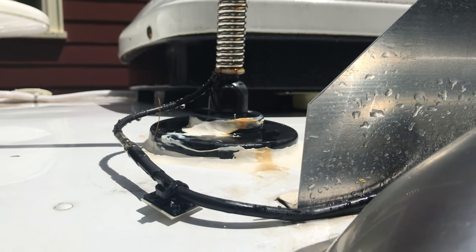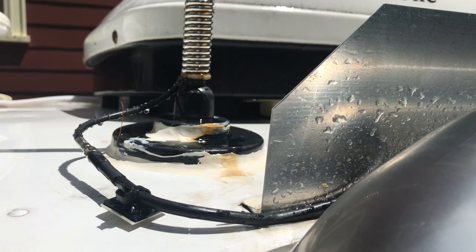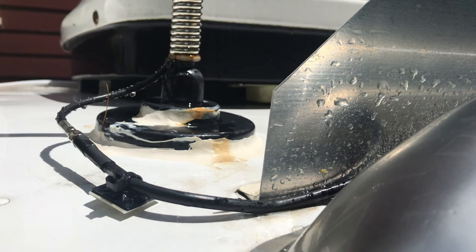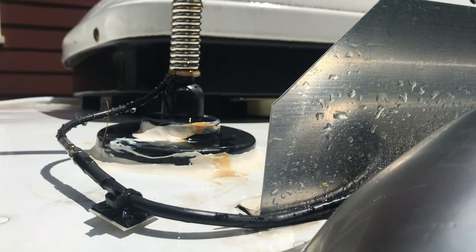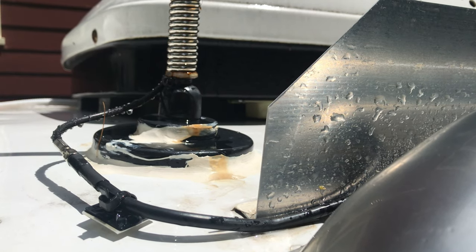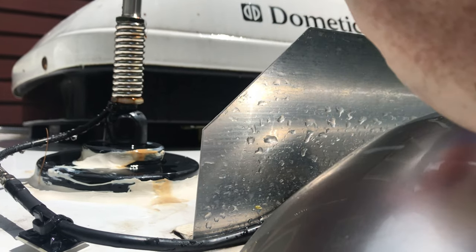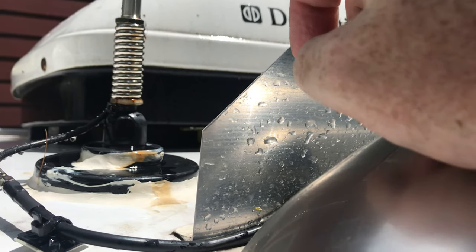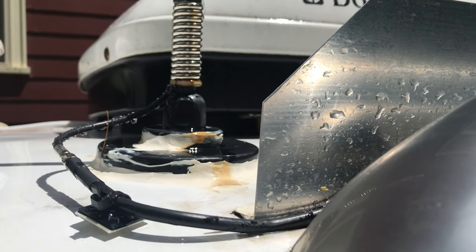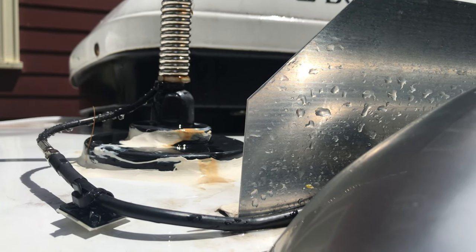Here's another interesting thing I found while inspecting as I clean. I installed this antenna last year and it's doing fine, but you can see the sealant around it is actually scorched. I think that's a combination of the black antenna mount absorbing heat, and more likely the back of the fin reflecting sunlight right onto the antenna and cooking it. I'm going to come back once it's dry and put some tape or something on the back of that fin to dull the reflection and prevent it from catching fire.